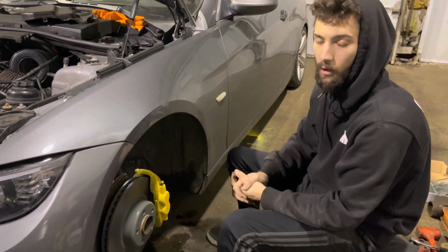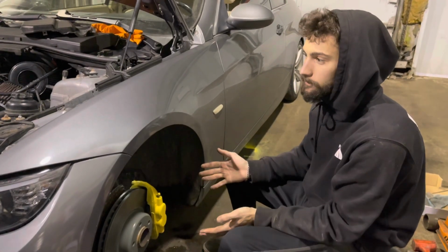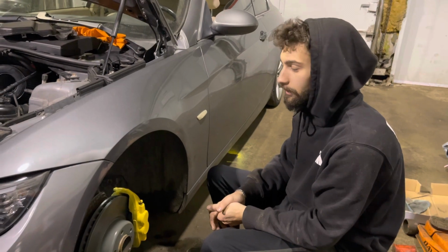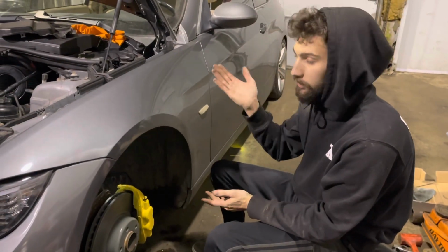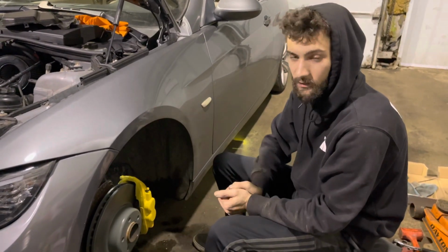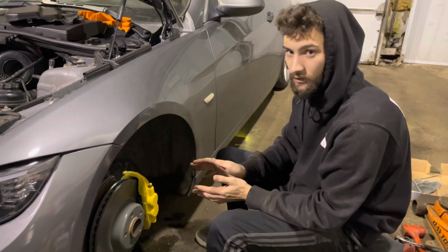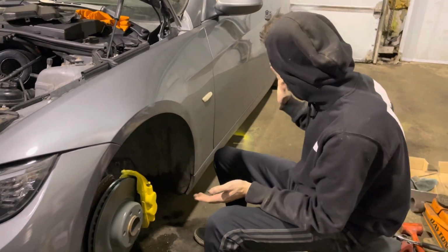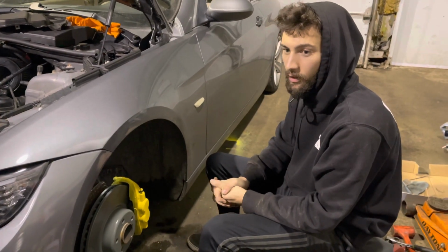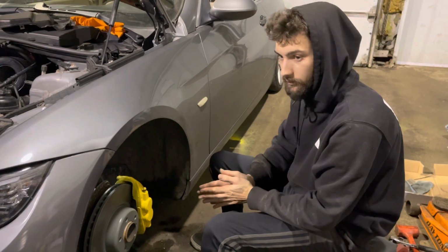You will be seeing this car a hell of a lot more, and on top of that, I really don't know what I'm going to buy for this thing yet, but we do have like a 400 horsepower car right now out of the gate. So I know I need to buy coilovers. I already have a set of M3 wheels over there off another E92 chassis, but I don't like how 19s fit. So I need to find a set of 18s. If any of you have a nice set of 18s and you're local to Connecticut and they'll fit this chassis, I was trying not to roll the rear quarters because this car is pretty clean, but I don't really have that option, because you can't really do that without rolling fenders if I really wanted to fit a 9.5, 10-inch wheel in the rear and a 9.5 in the front.